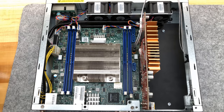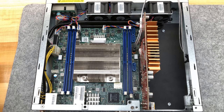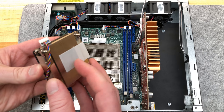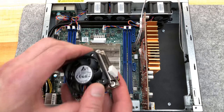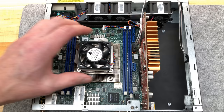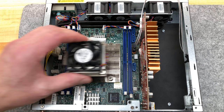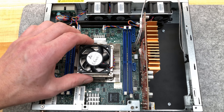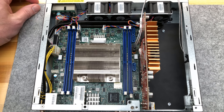I can't just grab something like the SNK-P0574L from the Xeon D-1500 days because that kit won't fit at all. The thermal paste comes pre-applied, and there's a profound difference in size — the heatsink fins always go this way, and the screws are nowhere near the same distance apart. The thermal solution is probably four to six times as much aluminum surface area, so this thing needs way more cooling. That's another concern if you're a power user.